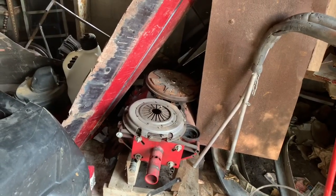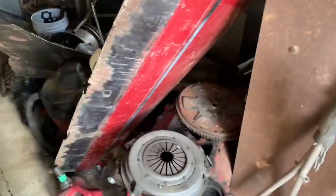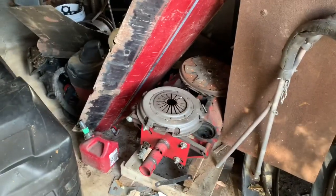I've done some research, and I think I'm going to buy a rotating assembly from, I don't know if you guys have ever heard of it, Skip White Performance or something like that. They sell stroker rotating assemblies, but they take the crankshaft, the rods, pistons and everything, and completely balance everything to itself. They'll balance every piston, trim off the skirts and stuff like that, make everything 100% balanced, just for the most performance. And I'm going to go all forged parts: forged crank and rods, and I don't know what pistons to go with, whatever they have. They seem like a pretty good site, so I think I'm going to go with them. You talk to them and buy it, and it takes like 2 or 3 weeks before they get it shipped out.